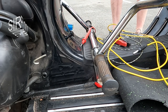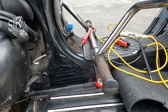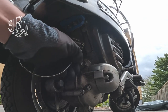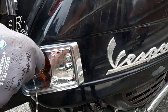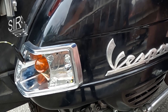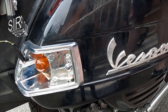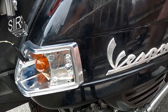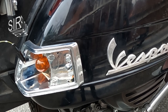There is one last connection I have not checked in detail, and that is the ground connection from the lamp to the chassis. When I make a bridge connection from the starter ground to the internal lamp ground, the lamp should work if there is a fault within this ground connection. But no, the lamp is still off. That is definitely not the culprit.